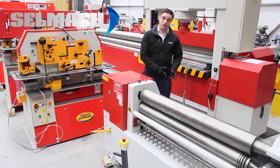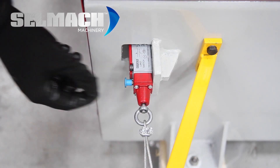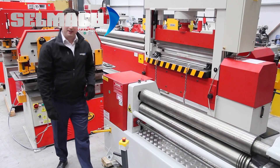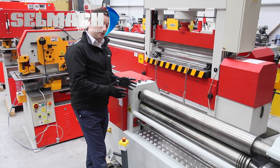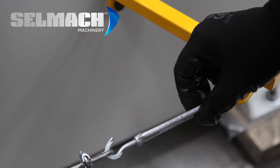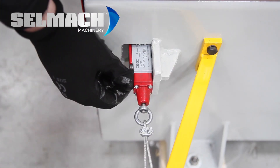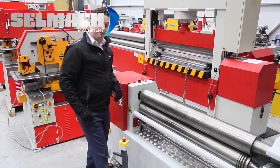So we've done a quarter turn on the turnbuckle and we trip the switch. We need to go around to the limit switch and pull the plunger, and then test the machine. If the machine is not working, we need to repeat those steps. So back to the turnbuckle, another quarter turn, trip the switch, around to the limit switch, pull the plunger, and then test the machine. BOOM!